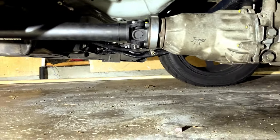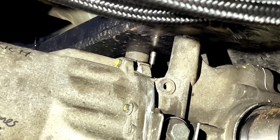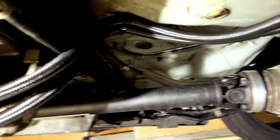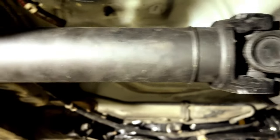Let's get under the car. A couple things before we end up doing a new drive shaft — it's hard to tell but you can see the shaft angle. I need to throw a couple shims on the diff where it mounts to that bar, between the diff and the plate it's bolted to, to kick the diff straighter. I've gotta get an angle finder and straighten that out. These metal adapters worked amazing for the stock drive shaft, but we're no longer going to need them because when you get a new drive shaft from PFT or S1 with their heavy duty one, they weld on the ends so you don't even need an adapter.